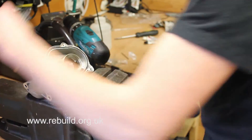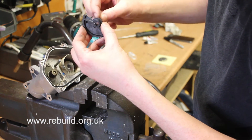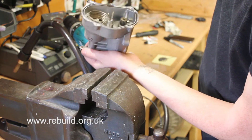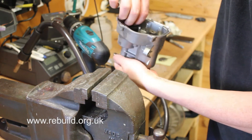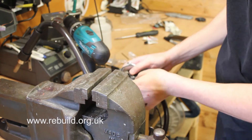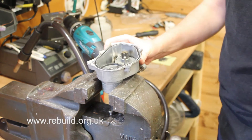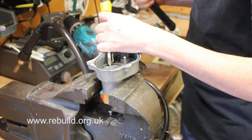Once that's done I'm going to apply again another small amount of glue to the inside of the half D. Fitting it's quite simple — you hold the tab, you line the whole of the half gear up with the spring. Once it's lined up you give it one full twist and then you hook it in place. You may need to tap it down to make sure it's all the way in. Once it's tapped down you need to get the pin and fit the pin.